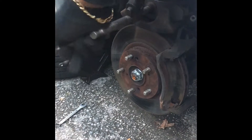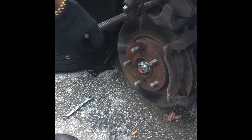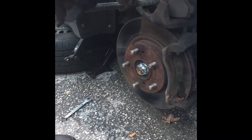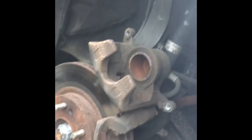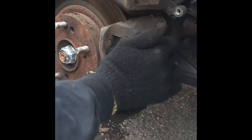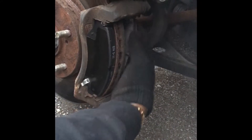I will have another video on my next brake job on how to fix a caliper that is frozen and won't move. As you can see, my caliper went in pretty good. So we're going to take that old brake out and put these new ones right on, in position. That's one. The second one goes in the back — make sure this side faces that way, or you will be driving with one backward brake pad, and that's not going to sound too good.